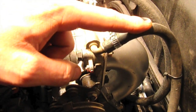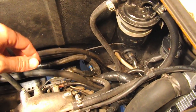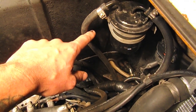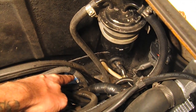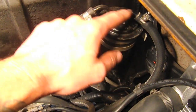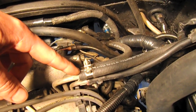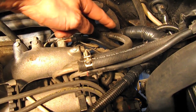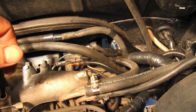We've got the coolant lines that connect up to it. Here's a shot of the fuel filter mounted to the firewall. The inlet comes from the fuel pump mounted just below on the frame member, and the output goes to the connection on the engine. Then we have the return line, which loops back and goes to the bottom of the fuel tank.